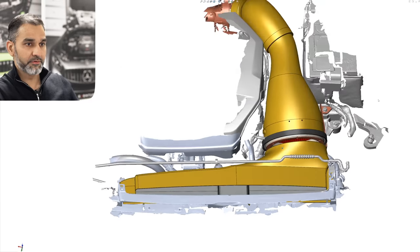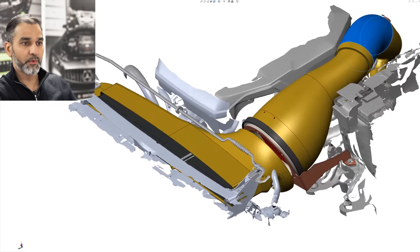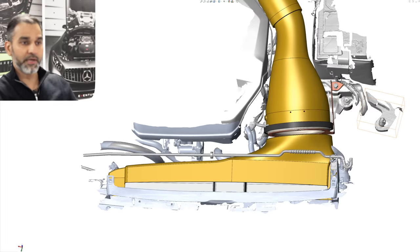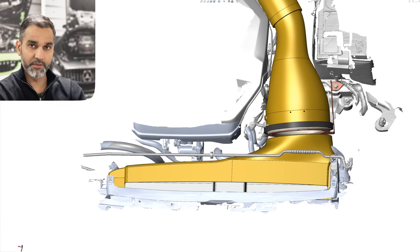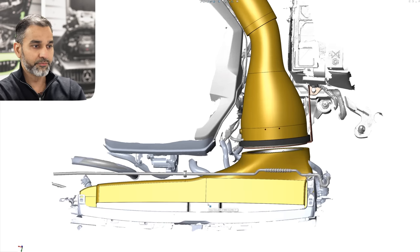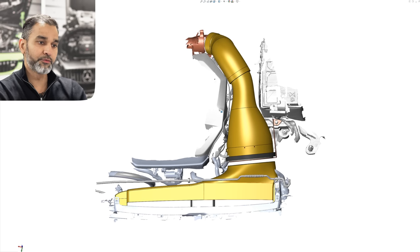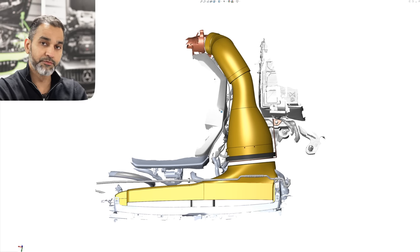That's the system in its entirety — everything is in carbon apart from the silicone tube at the back. It resembles somewhat the RS3 system, but it is a complete ground-up design compared to the Mark 7 system. It's oversized, using all the available space, and we've de-restricted it wherever we could — allowing a lot more volume and catering for future builds. When these cars are tuned, with hybrid turbos or full turbo builds, this intake will cater for much higher flow rates. The more the car is tuned, the more this intake will come into its own.